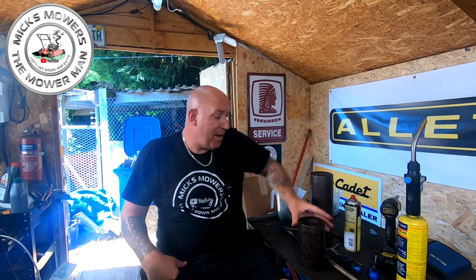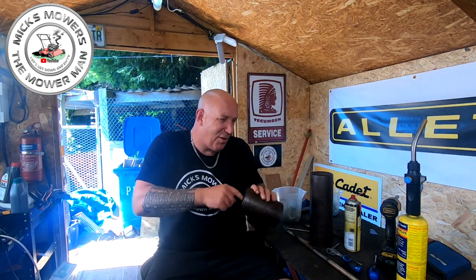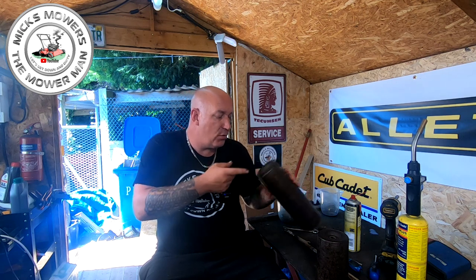With regards to the bearings and rollers, these bearings, they don't feel brilliant. There's a little tiny bit of drag on them. I can feel it's catching. So I'm doing a quick little video in a bit on how to remove those. So I have brand new bearings on there as well. The roller bearings inside the gearbox are okay. They're not too bad at all. And so we should be golden.